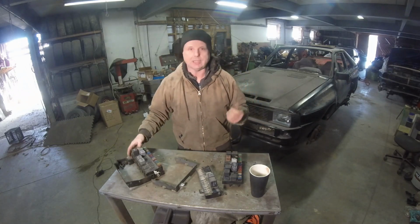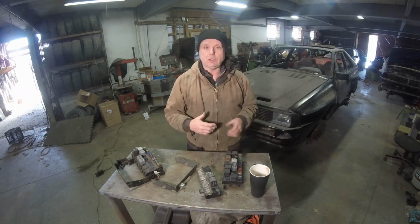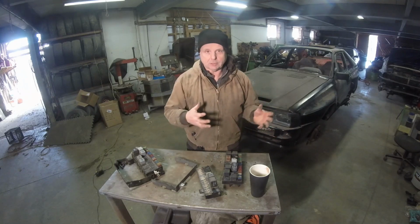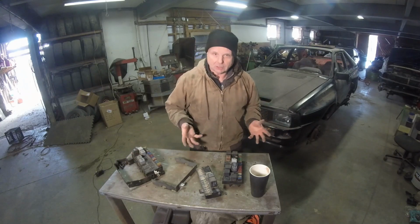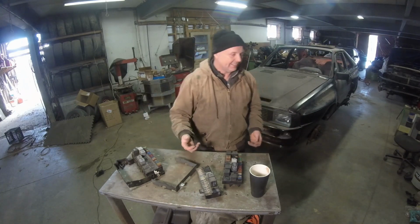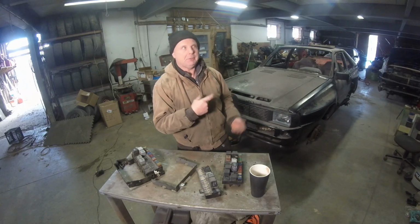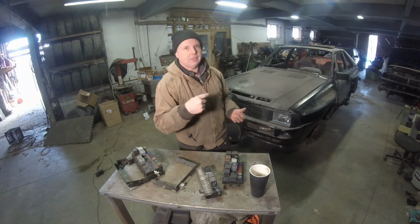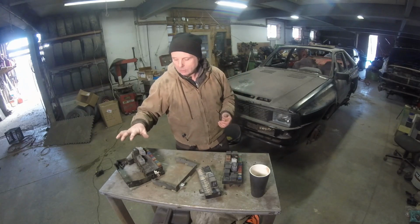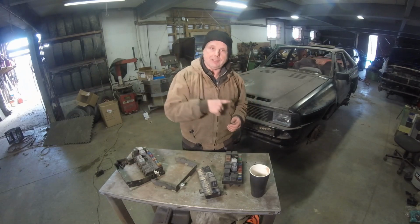But the first thing I have to do is put the steering column in, put the clutch pedal in, and do all that stuff to figure out I have no obstructions with this. Plus I have to put the bottom console in, because you don't want to have this all welded in, then try to put the bottom console in and have to re-weld it. That's not what I want to do. So let me throw the steering column in. The steering column's in. Let me throw the brake booster in and the clutch pedal in and all that stuff. That way we can figure out where exactly we are going to make this system right here fit.